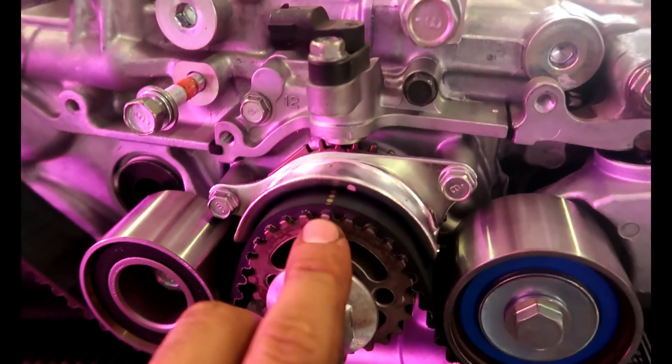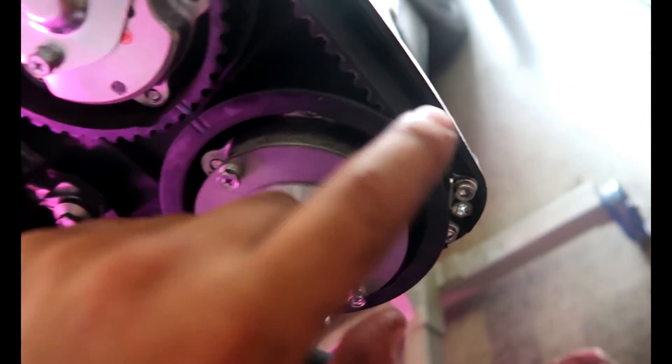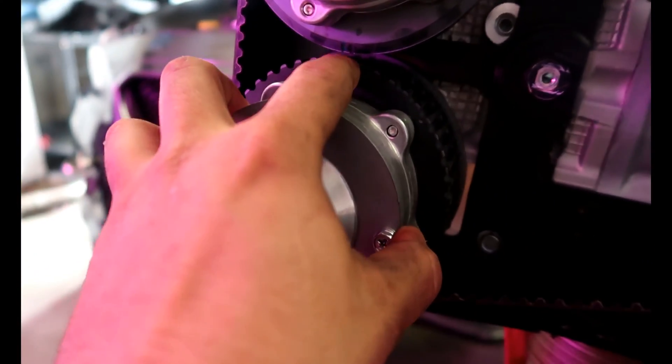See the dotted line right here — that's gonna go for the crank. Then it has like four solid lines, that's for the cam gears. As long as you have them lined up correctly — this marking with this indent right here on the cover, same thing on this one, and these two — as long as you have those all lined up, you're golden. This is not going to be 100% perfectly lined up but as long as the markings are good, you're good.